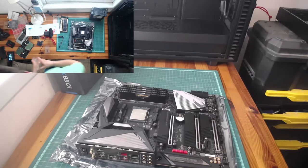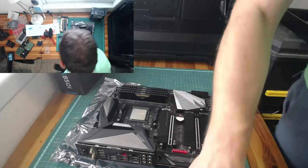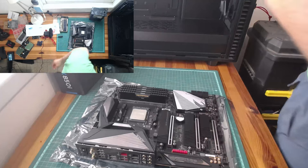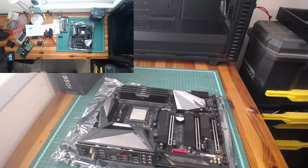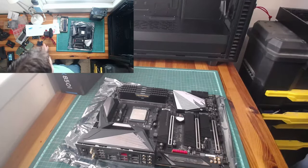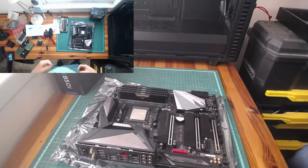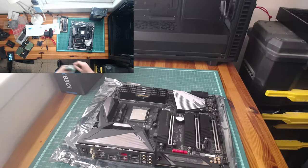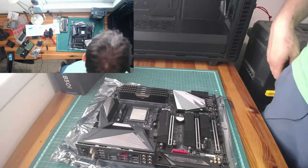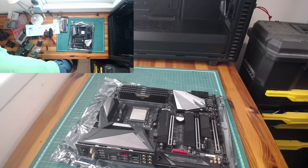Originally I was going for a Threadripper build. Same 16 cores. They will run a little faster, but they're of an older architecture. And of course it'll also run much hotter. So that was a trade-off that I was willing to forego, because it would have been more expensive, hotter, harder to cool, and just everything more expensive. And this CPU is supposed to give me very similar performance for less money. So that's how I was also able to upgrade to 128 gigs of RAM instead of just 64. When I say just 64, I sound really bad, don't I?